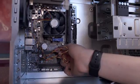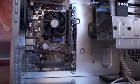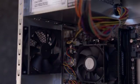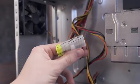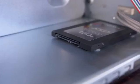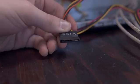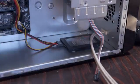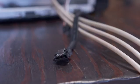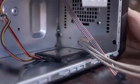Now it's time to start cabling. First up grab the cable running from the rear fan and plug it into the system fan header on the motherboard. Next you should find the 4-pin CPU connector from the power supply and hook it up to the motherboard on the top left. Then grab the long 20-plus 4-pin cable and plug that into the corresponding connector on the board. While we're here let's power the SSD — grab a SATA cable from the power supply and hook it up using the larger of the two ports on the drive. Next there's the SATA data cable that came with the motherboard; it has a notch on one end so it only goes in one way. Hook one end into the motherboard SATA port and the other into the SSD.